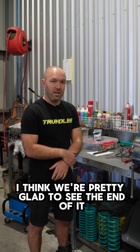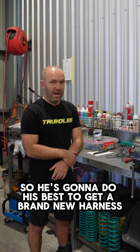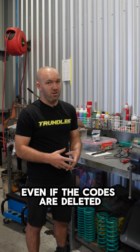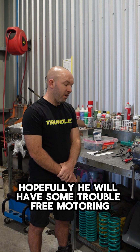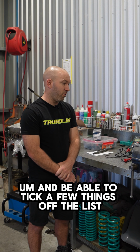I think we're pretty glad to see the end of it. So he's going to do his best to get a brand new harness, and we'll remove the unnecessary wiring, because if you get water across terminals, even if the codes are deleted, you can have major issues going into limp mode and cutting out and whatnot. And once that new harness is in there, hopefully he will have some trouble-free motoring and be able to tick a few things off the list.